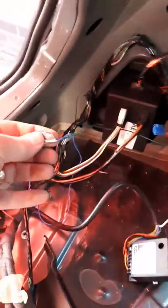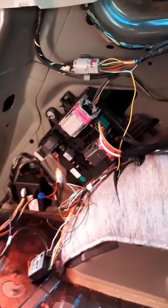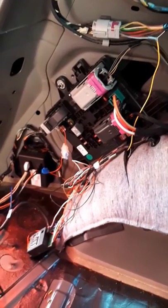To pick up the left hand side lights, the green wire which comes from the unit has to be extended around the back to the driver's side of the car, and that joins into a blue and purple wire just behind the trim. As you can see, you've got to remove a lot of trim to even get to the system, but finally it is working. I hope this is useful — thanks guys, bye.